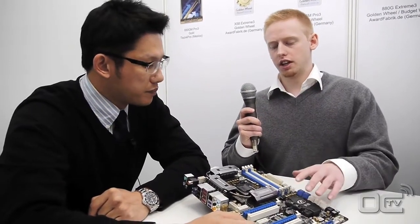I have to ask about the SLI and CrossFire support you mentioned. It runs triple CrossFire X. But how about SLI — is it two or three-way? The SLI is two-way because the PCI Express SLI lanes run at x16 or x8/x8, and the third slot is dedicated at x4.